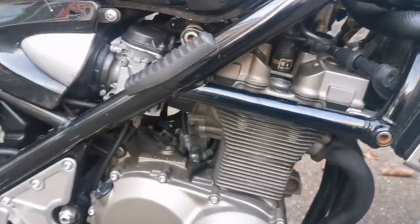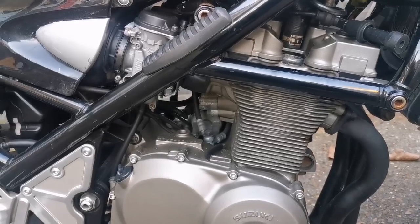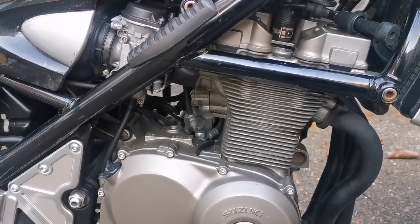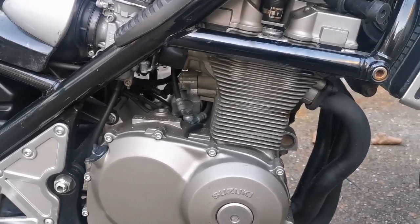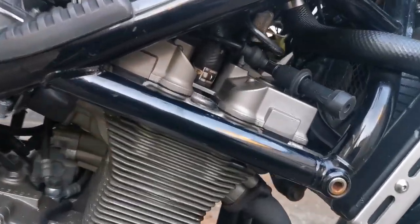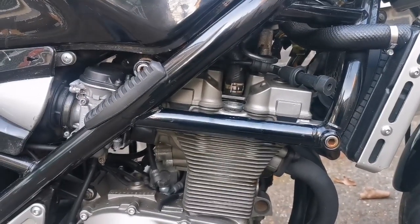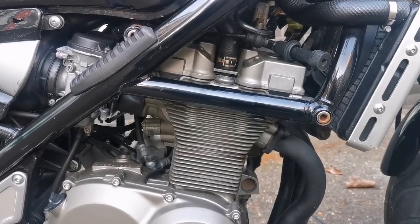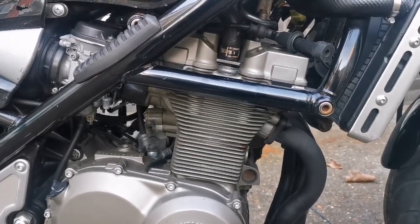Now, there's kind of two ways a spark plug can snap. The middle can spin out, leaving just the threads in. So imagine you look down, you see a massive hole, you can see the piston, but you can't actually screw a new one in because the threads are still in there. That's a fairly straightforward method of extraction. You just get the tools that I'll show you later down into it, and generally they can pull it out. That's not the end of the world.